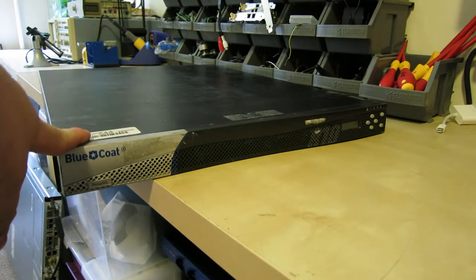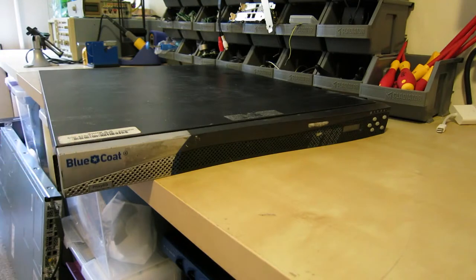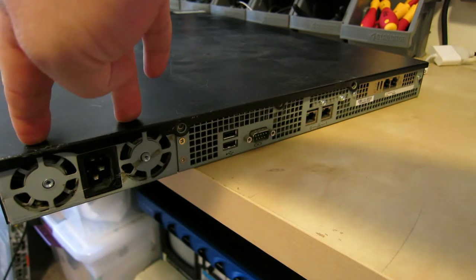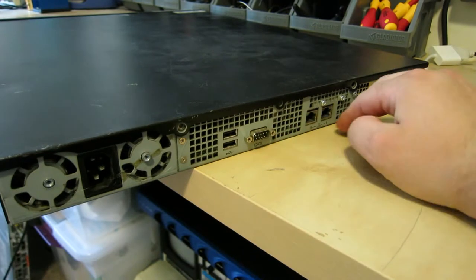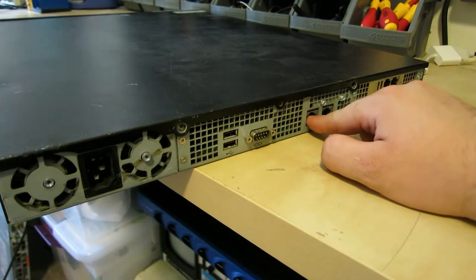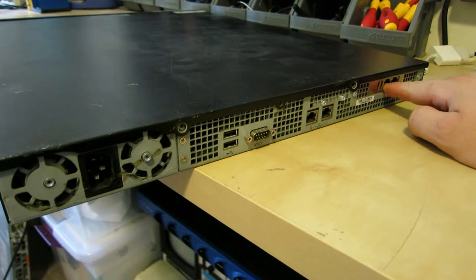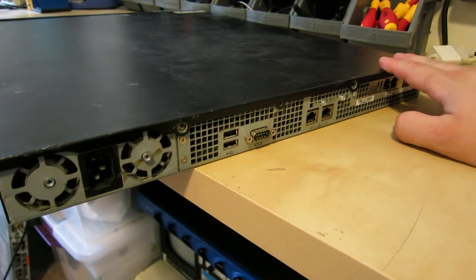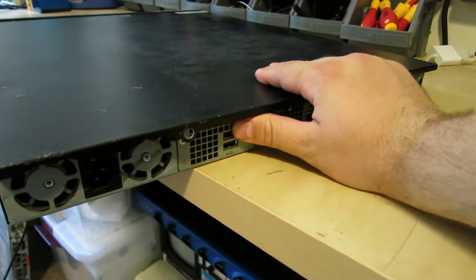Like most Bluecoat stuff, there is a custom motherboard inside and it's kind of useless. Around back there's a standard power supply — well, somewhat standard because it's got two fans in it, which is a little odd. There are two USB ports, a serial port, and two ethernet ports. I initially thought they might be 100BaseT, but they are gigabit, as are the two ports on the bypass card with relays. On the back it's definitely not a regular PC — there's no standard array of connectors.